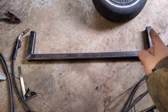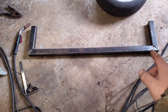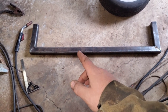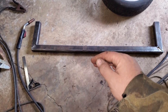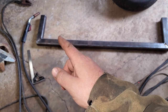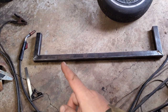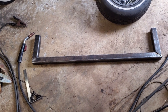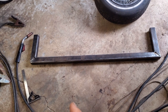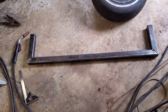If I've completely lost you, let me show you what we're working with. I've been doing all kinds of different stuff, not just the bridge. So this is basically what we're working with — that right there is going to connect to your frame rail, and that right there is going to connect to your frame rail. This is going to go underneath the car. I'm going to put mine about a half inch, maybe an inch or so, behind the core support. I think it sits below the core support just a little bit. I was going to put it even with the bottom, but my radiator hose will hit the side and I don't want to prematurely wear out a radiator hose. So I dropped it down just a little bit — it's still kind of hidden, which is what I was going for. I'm about ready to throw it in the car. I'm about to cope those edges in the back because I wanted the front and the back to sit flush against the frame. I'm going to hang it up there, mark it out, and start cutting.